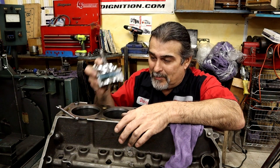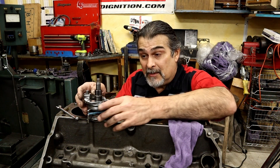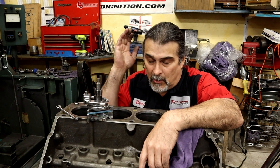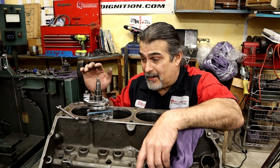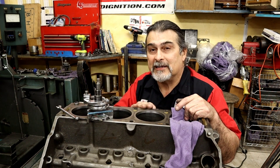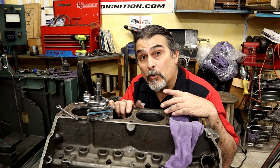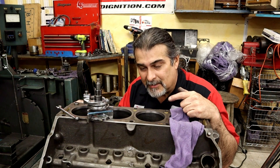I would rather have an older tool than the stuff being made nowadays. This one is worn out — I've had it since I was about 18 years old. Back in the day we used to cut ridges all the time; now we very rarely do — we just bore it, hone it, and it's out the door. This is a restoration: we're going to put a nice hone on it, a fresh set of rings, and it's a restored motor with very low miles — a Ford FE Thunderbird. We're cutting the ridge because it doesn't need to be bored; it's going to hold a set of rings and probably last another hundred thousand miles.